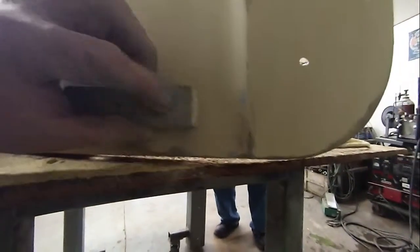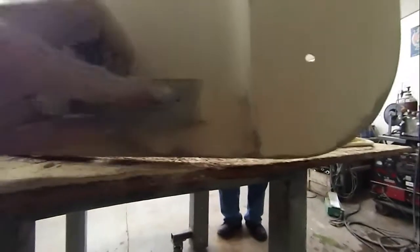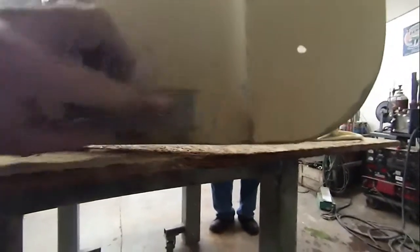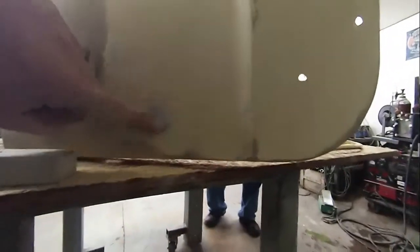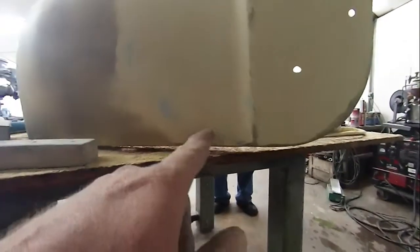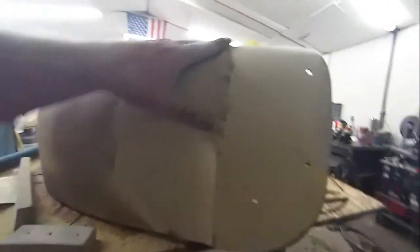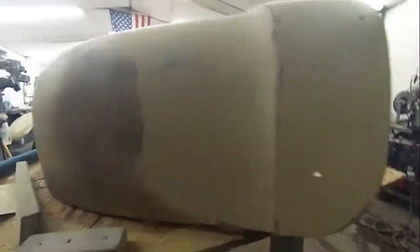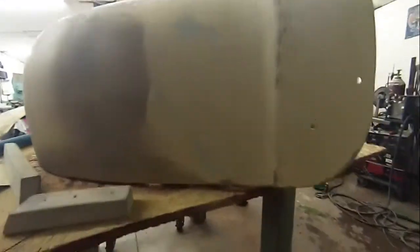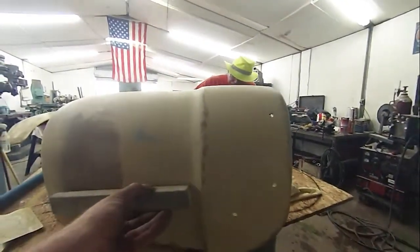and as I say, you put your block clear across it, and you keep your block clear across it. Okay, you just work it like that. And as I say, I can see where I'm busting through into the epoxy again. But as you see, our low spot is quite diminished. So that is the technique for working that, where you're in kind of close quarters and you got a low spot you need to work out. But it's kind of ineffective using this huge block. That's where you're at.